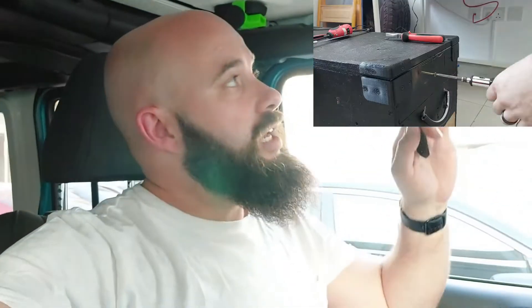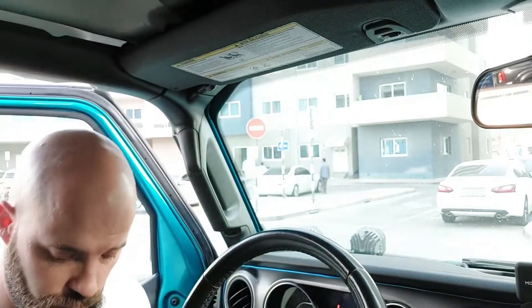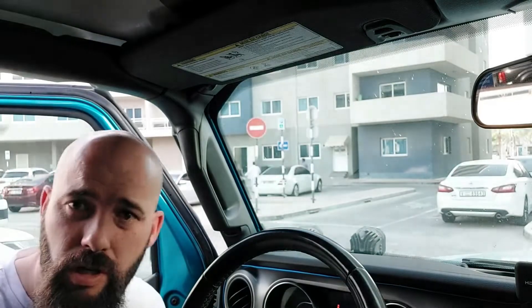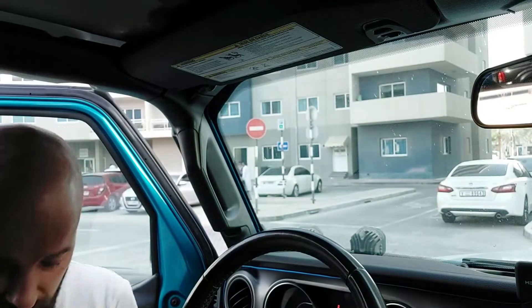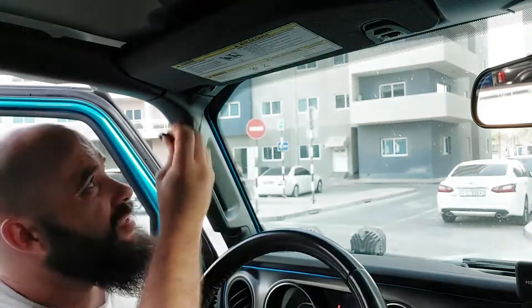For this install it's super easy. All you need is a T20 Torx bit to remove the stock Jeep screws, and then I'm using 35 millimeter long, thick — I think four millimeter — screws that I had to cut shorter with a little Dremel bit. Then I just screw them in with a Phillips screwdriver. So I have my T20 Torx bit, my Phillips screwdriver, my two shortened screws, and my 3D printed part. I'm going to remove the T20 screws and put the new piece in place.